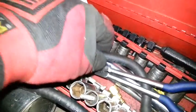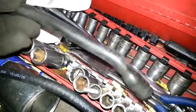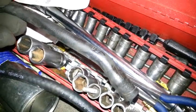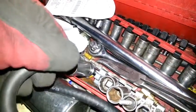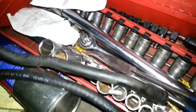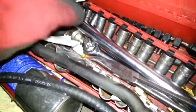And this is the cover that's supposed to be on that PCV hose. But by the time I get big enough to be able to attach it, this guy won't fit over it. Maybe I can see why spending a dollar or two or three on hoses versus paying twelve dollars for the correct fit is all the trouble worth it. And now here is that original hose from 1999. I probably should have replaced it years ago. It's just totally ballooned and big on one side, and tiny on the other.